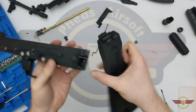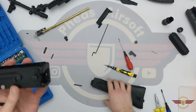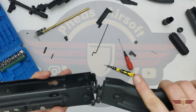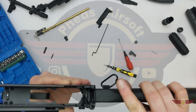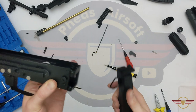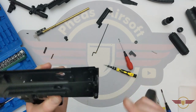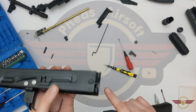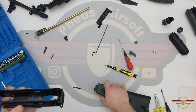The pin wasn't shaped at all — it was actually just a solid single piece, but it was well wedged in at the top. So all I did was knock it out, and the stock's come off. So you can replace the stock — you should be able to do that without removing any of the other parts we've removed, as long as you can get access to the bottom of that pin, you should be able to do it quite easily.